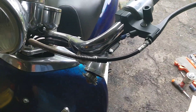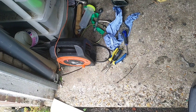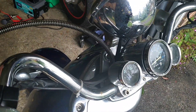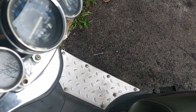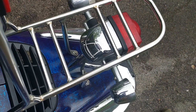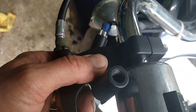Alright, that's one on, and I'm really quite annoyed because the switch doesn't work. I've had to cut the cable. The brake light comes on when I connect the two terminals, which obviously also allows the engine to turn over. But when connected and pulling the lever, I get an audible click but no lights, which is really annoying. I'm going to have a tinker and see if I can fix it — I've already emailed the company.